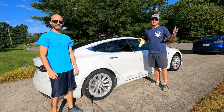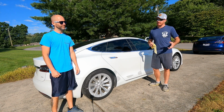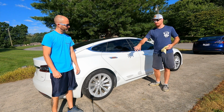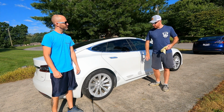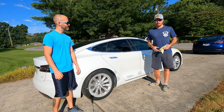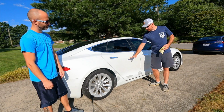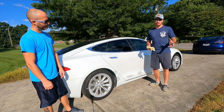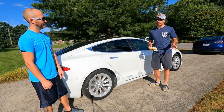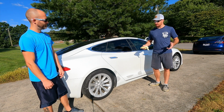All right, guys, it's actually the next day. Everything's good and dry, so today's going to be paint day. We'll be sanding this down. We're going to start out with some 320 along the bottom, wet sanded. We'll move up and use some scuff stuff. We'll show you guys that. I think we've used that in the video before. And we're going to use the scuff stuff up into the line to where we're going to stop with clear coat. We're going to blend. So I'm going to wipe it down with some wax and grease remover right now. And we'll start sanding.